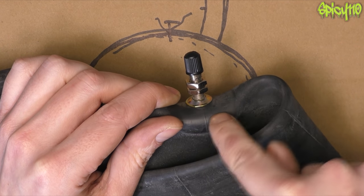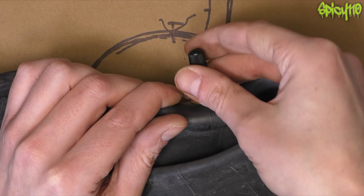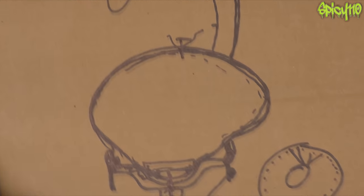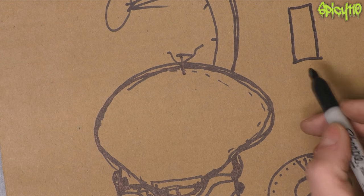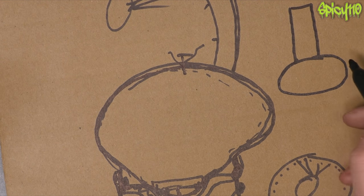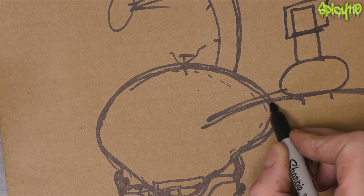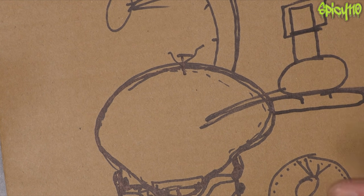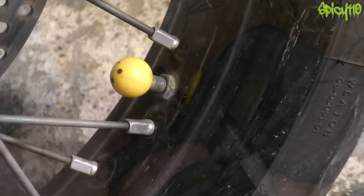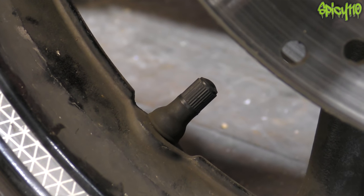There is one easy way to tell on any of these: the valve. On a tube tyre the valve is attached to the tube itself and protrudes through the valve hole. On a cast tubeless rim there's no inner tube, so you have a separate valve - it's just a rubber-grommet type piece that goes through the hole and has a rubber section on the inside that seals against the cast wheel through pressure and tight fit. If on the outside of your rim you can see a nut holding the valve down, you've got a tube. If it's one of those rubber grommet-style valves, you've got tubeless.